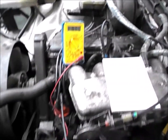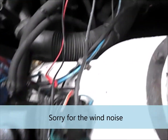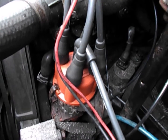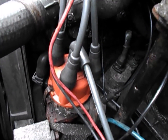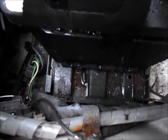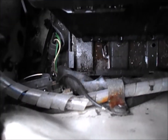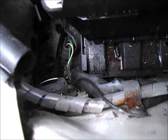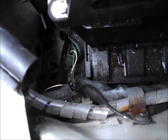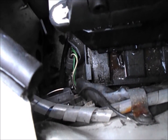This may look incredibly alien to some, or may look incredibly familiar to others. This thing down here with the orange cap on it is a distributor. That sends the high tension into the spark plugs into the cylinder head. It gets its signal from a big coil down here. And down there, where it can get rained on and condensated on through the decades, is an ignition unit, which I suspect is either not working, or the wiring to or from it is possibly degraded. And we're going to check that out.